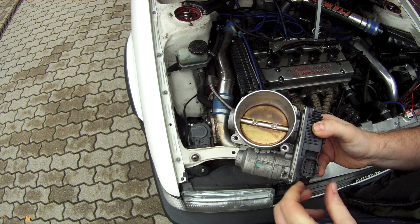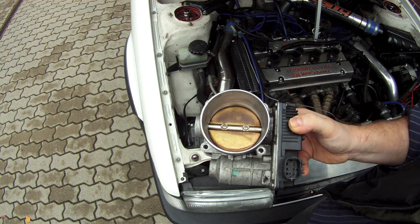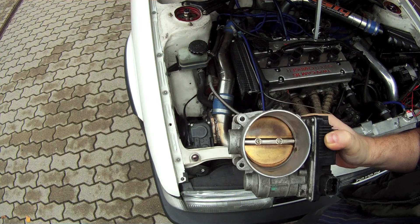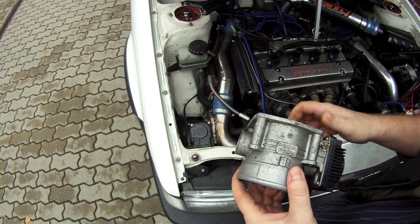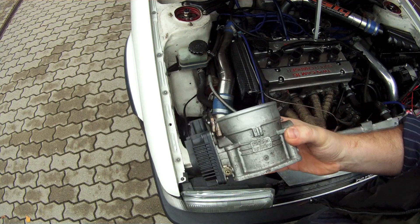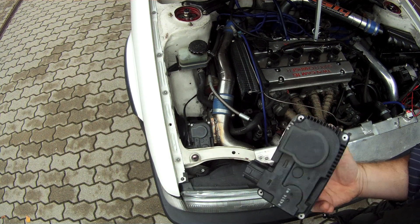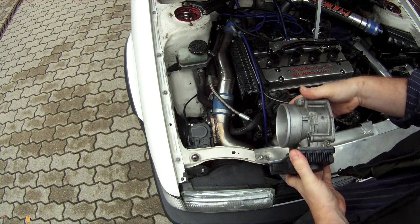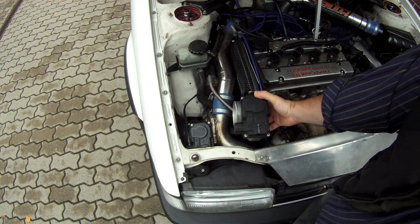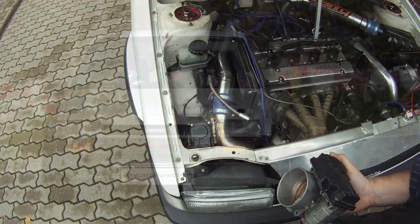The very nice thing is that you can use it in binary mode — fully open or fully closed — using just two pins. Not every electronic throttle body can be used this way, but this one works great. I've used it for quite a while now and I can advise you guys to do the same. That's it — I hope you find it useful. Twin charger systems, or at least turbo, are really lots of fun. Take care.